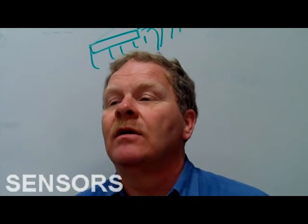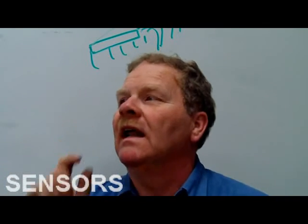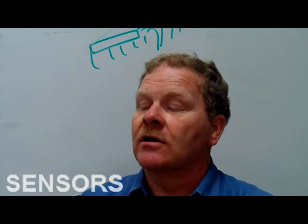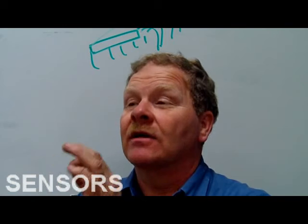We tested by that, but I don't know about no air test. Well, think about your shift solenoid. What's it doing? Remember I told you about the shift solenoid stopping up a passage? Oh, yeah. All right. So you know what I used to do with a shift solenoid to test it? I would take that shift solenoid, it's got a little port end on it. I would blow in it like that. And I had my little wires hooked up to the two wire terminals, and I would touch the power around, and it would go click.